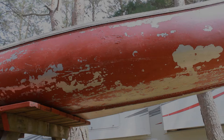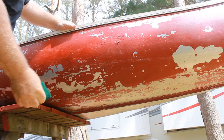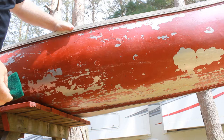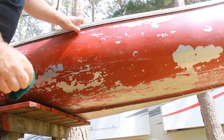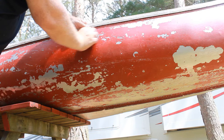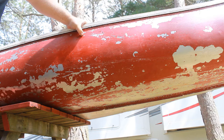There's nasty red paint here, but it strips off real nice and easy, and the aluminum underneath is in quite good shape. I put a gel paint stripper on and it lifts off nicely — it's only been on for a few minutes and it's supposed to sit for 15. The cheap paint just peels back nicely. When I get this home I'll give it a good coating of the stripper and start scraping. For the little scrapes and nicks, I'm going to try out wet sanding on the aluminum, starting with 800 grit wet sandpaper.